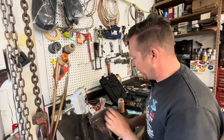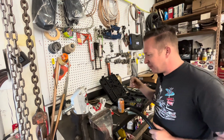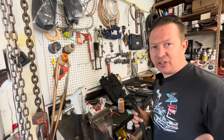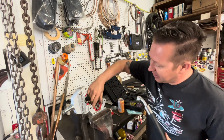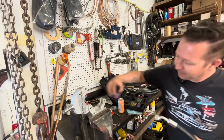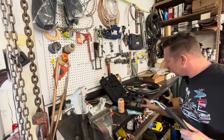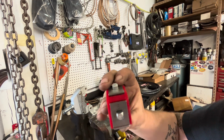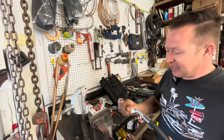Okay, here's our crimper. It has different jaws or dies in the kit for different size hoses, because this kit uses a number 10, a number 8, which is what this one is, and a number 6. They just pop out, and then the other ones pop in, just like that. So we'll put the number 8s back in. They're labeled number 8, so you know what's happening. They sit in there like that.